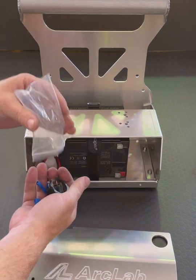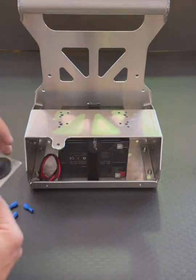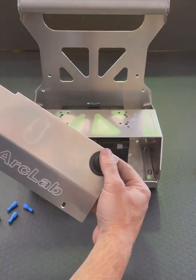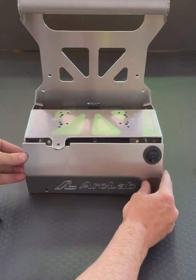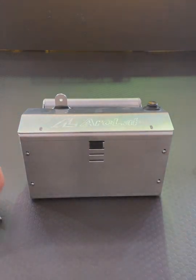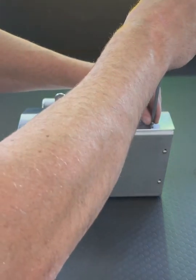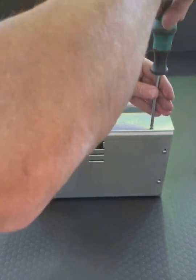I'll just quickly pop this switch into the front panel, and even though we haven't wired the shuttle up yet, we're going to put the front panel on and check out what she looks like. Left out of your supplied hardware pack, you should only have two machine screws left for the front panel — they do not require nuts, as the shuttle is tapped and the faceplate simply screws on with threaded holes. The faceplate has small vertical slots for fine adjustment so that it sits absolutely perfect once you close it up.